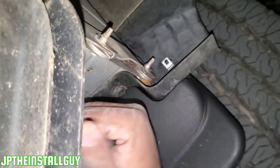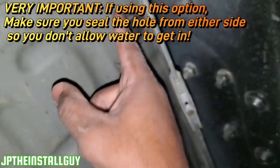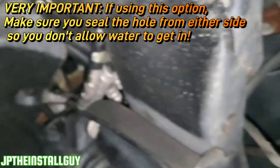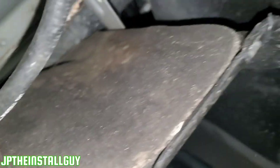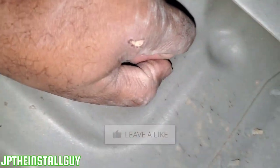This right here is where our step rail is, up on the driver's side. It looks like we have one grommet right here and a bigger grommet right there. In order to use that, what would probably be best is to take your wire and run it straight down through the backside of this fender. There should be some wires coming down, and then there are holes in the frame you can zip tie to. Then you can come down here, zip tie to these holes if you wish, and then pop this little deal out or push it in.